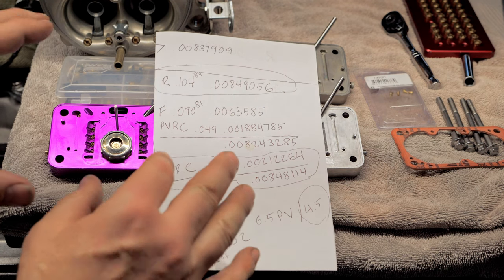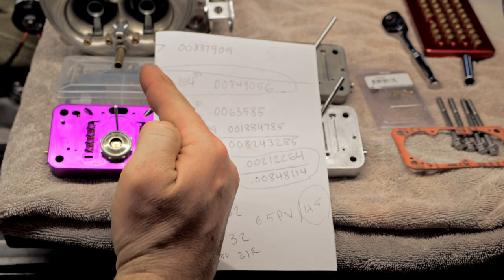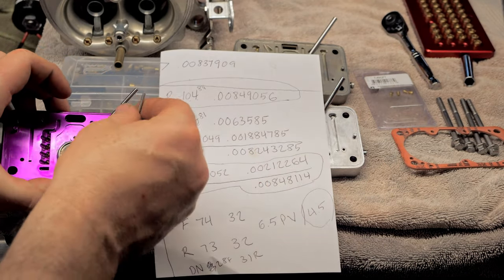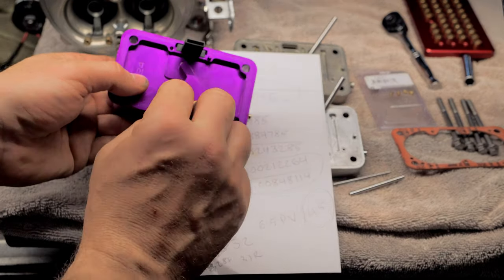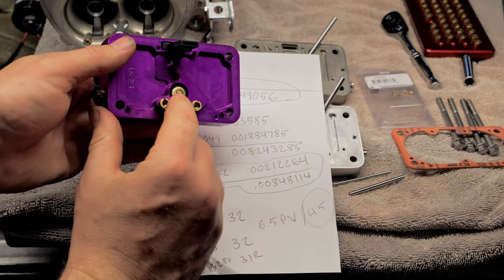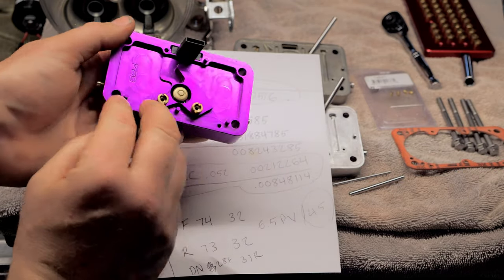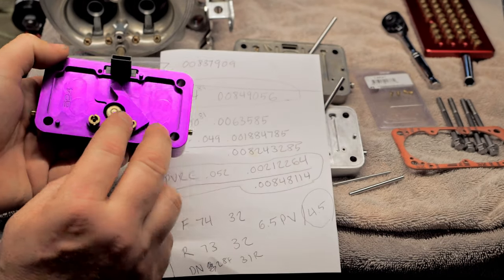And it was a great cruising, but what happened was, when I was shifting gears, it would go lean for a second, then back to a good enrichment. And the reason why that happens is, when you have a big spread that you have to rely on both of these, here's your power valve, right? Vacuum, when you change gears, this will move in some, which will slow down the flow to the jets that are in here. So I'm relying less on this and more on these guys